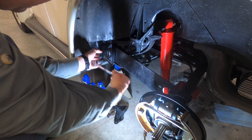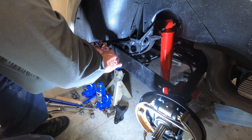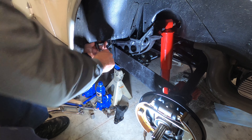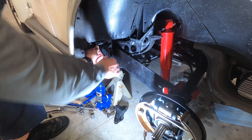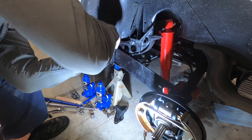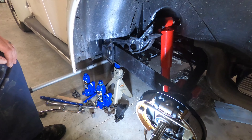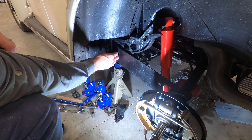First, you're going to take off the three bolts from the axle tube, but you've also got to loosen your handbrake cables. There's the bolt for the bottom strut that I've already taken off, and then you have the four bolts that I'm taking off right now to remove the plate to get access to the torsion bar.